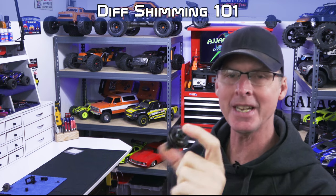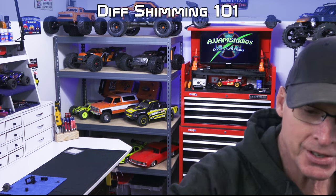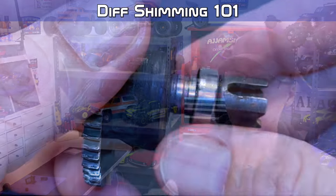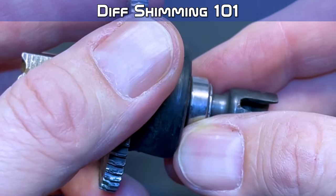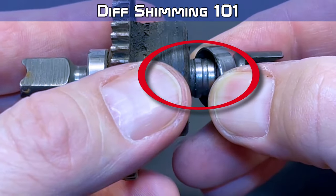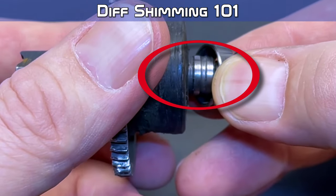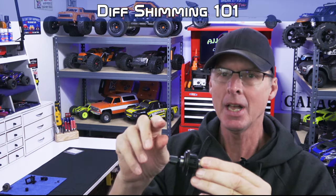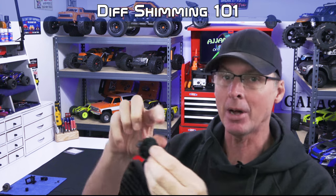So if you're having trouble getting the spacing, the problem is with these, and I'm going to touch on this again, guys, because this is really important. These bearings, and have a look at this. This is a destroyed bearing that we've got here. And there's the race, and see how small that gunnel is that the bearings roll in? Well, in these things, that is not a great thing. It's not encased like the automotive ones. It's just kind of running in a channel, and that channel's not all that deep on either race.